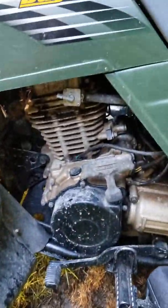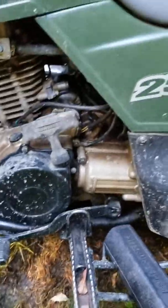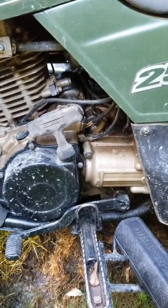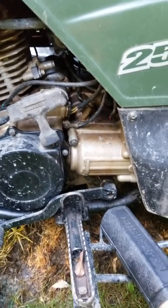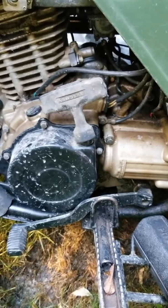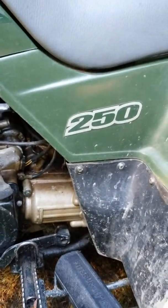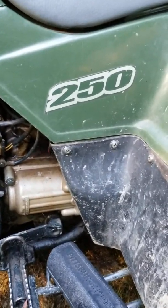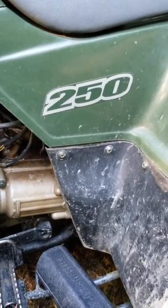I had posted a couple of videos because it wouldn't run. The motor would turn over and everything, but it would make a clicking noise like the gears were just spinning — they weren't making a connection to actually start the motor on the four-wheeler. So I had a guy looking at it for me and it kept shearing off the woodruff keys. Couldn't figure out why. I was paying around four dollars a piece for a woodruff key.